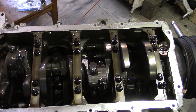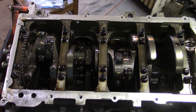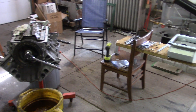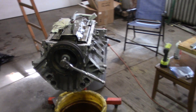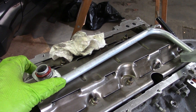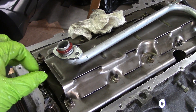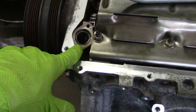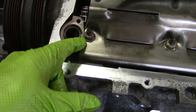That's probably about all we're gonna do to the bottom end here. Now, we're all ready to put that oil pan onto this engine. First we gotta install a pickup tube. The instructions from Renegade Hybrids say to take the original O-ring off, coat it with oil, and stick it on here — no problem. Problem is, when I stick it down in here, this tube hits the windage tray right about here.